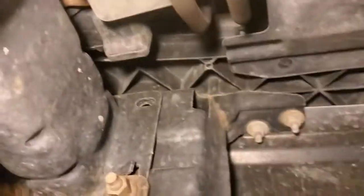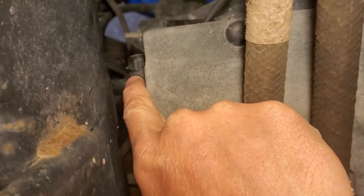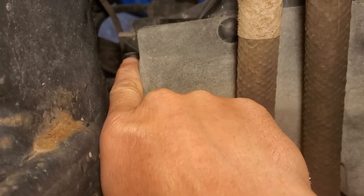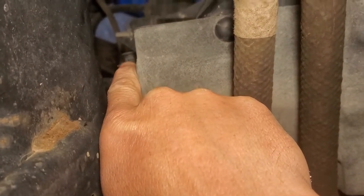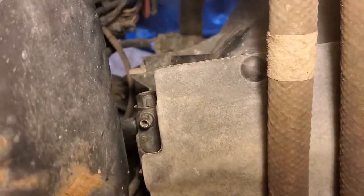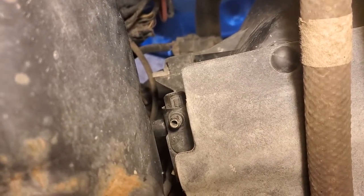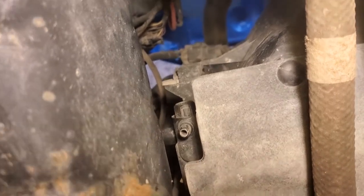After it cools down, I'll show you what it looks like to drain it out of the rad. So we're under the truck. There's the bottom of the radiator. Right there — that's where the coolant's going to come out of. It's got a 16mm socket that goes on it. It's got this little tab here so it's not going to go on all the way. My theory is so that you can't torque it down too much — that is all plastic. So I'm going to use that to just crack it and get my fingers under there. Bottom of the rad, driver's side.